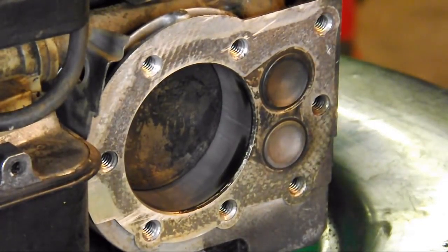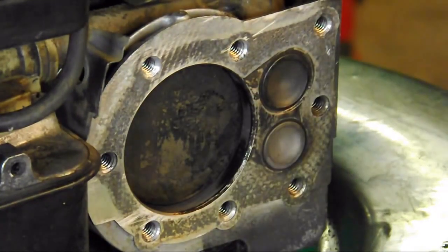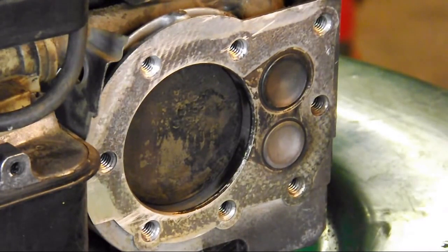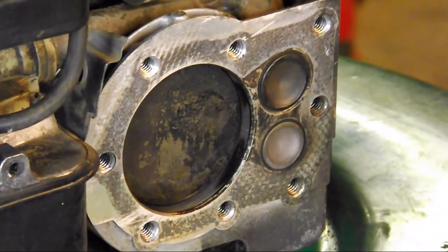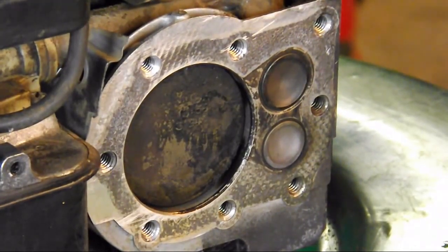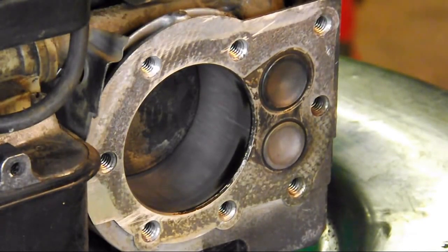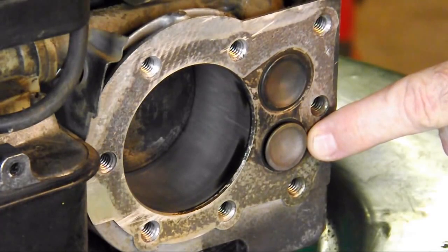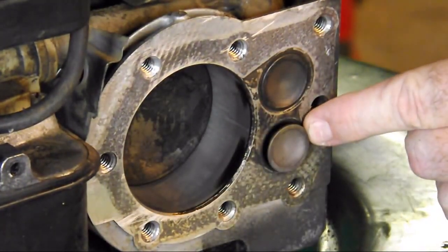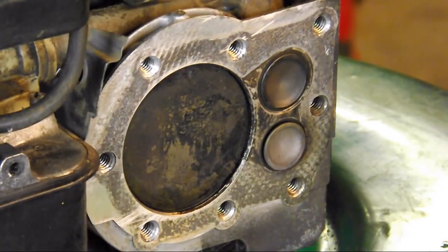They've found that if you compress air and fuel it explodes better. So right before we hit the very top, the spark plug emits a spark and an explosion occurs. With the momentum of the flywheel and the lawnmower blade carrying it over the top, this starts our power stroke. As the fumes expand and burn off, they force the piston powerfully back down the cylinder — that's our power stroke. When we hit bottom dead center again, the exhaust valve opens and the piston comes back up, forcing those spent fumes out through the muffler port. That is a four-stroke engine.